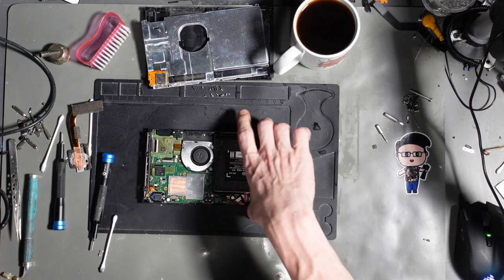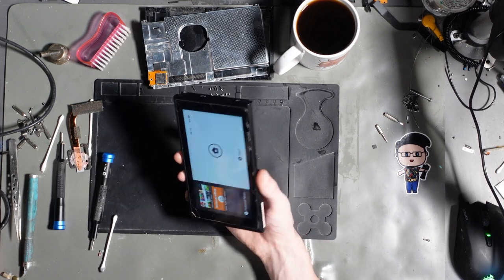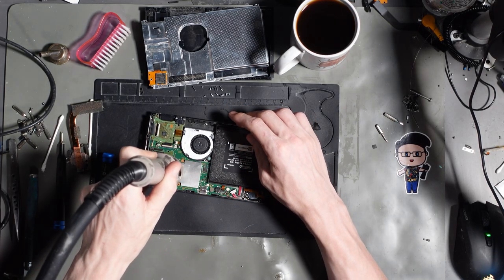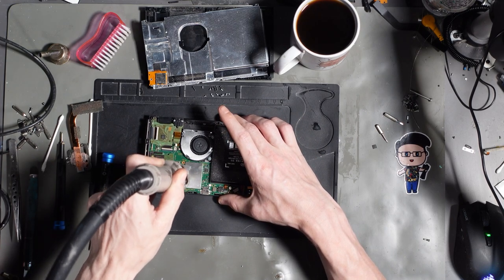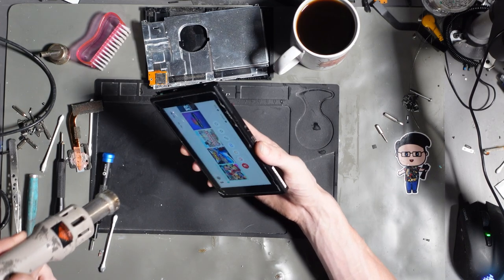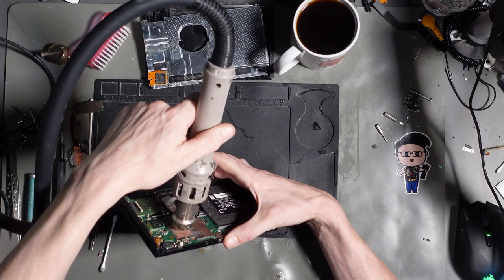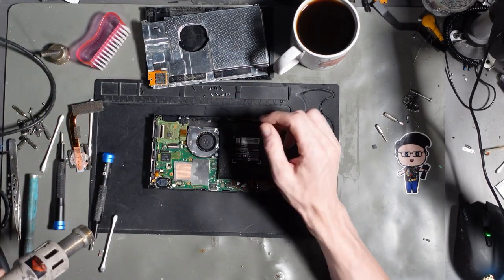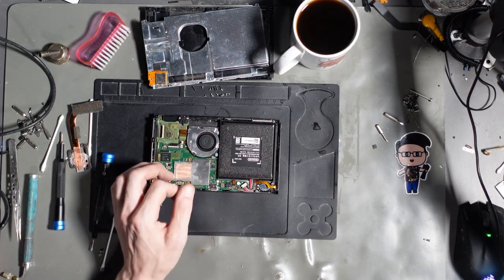Let that reboot. I'm just going to heat up the CPU directly just to see if the fan kicks in, and that's probably going to tell me how it's overheating in a second. Yeah there you go — console's too hot, fan's not kicking in, and it is plugged in. Okie dokie — it's not a stuck fan.